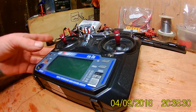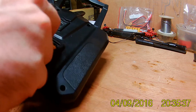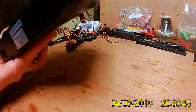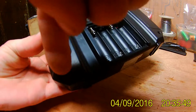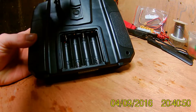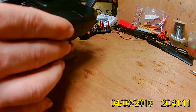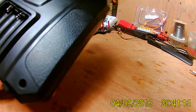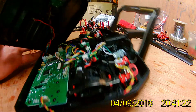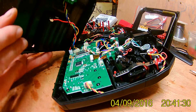We're probably going to fit them first — take the battery back cover off, take your batteries out. Then put it to the side. We have got one screw there, one screw there, and two at the top. Then pull it apart — get rid of the handle bit — pull it apart slowly as there are going to be wires attaching to the port on the back and the battery connectors, so make sure you don't pull on them too hard.